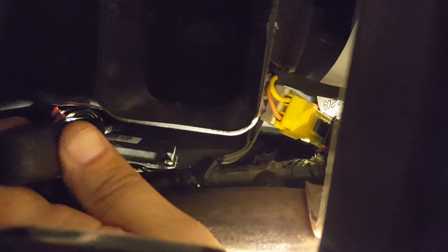All right. Good spot. Let me grab the flathead. What I did is got a flathead right in here on the teeth where there's a notch made in the actuator, and this goes all the way down to the blend door. And I turned it from left to right, and that gave me cool air. It's all the way to the right for cold air right now.